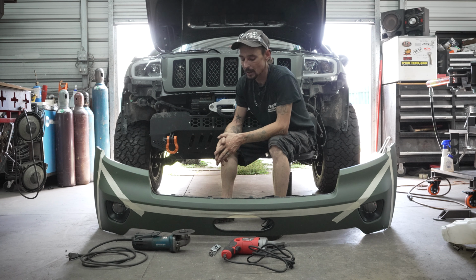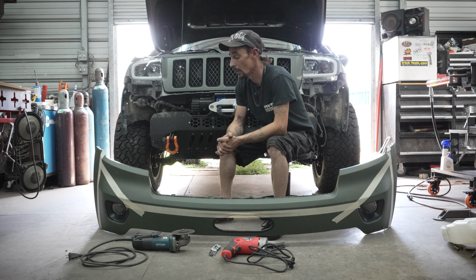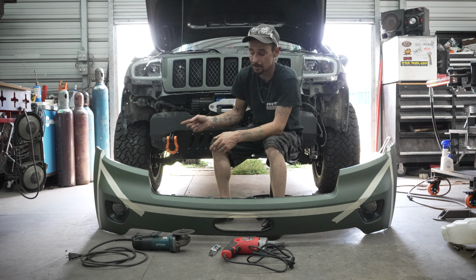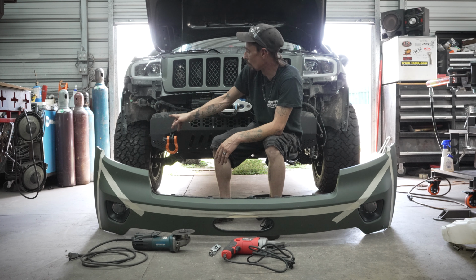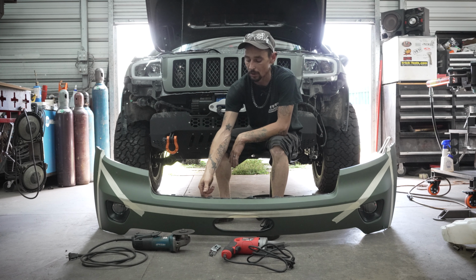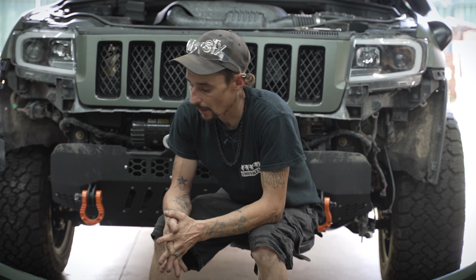All right, so once you get the top masked off, just go ahead and remove it. It's really simple to remove. There's a couple 10mm bolts on either side up in the fenders. You're going to remove those. There's a couple pop tabs in the fenders, remove those, and then the entire upper fascia will just pop off. It's all little pop tabs, really easy. So now that we have this off,